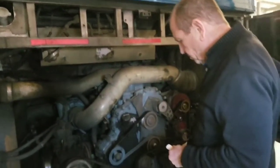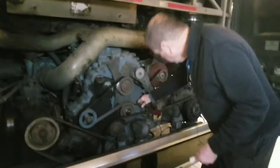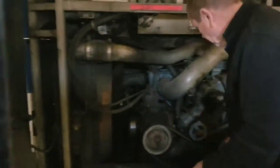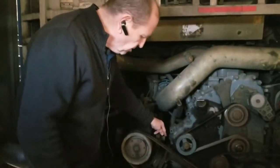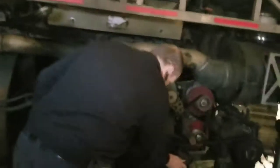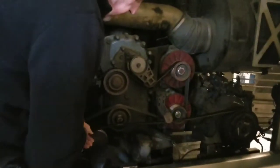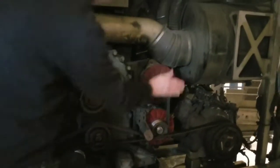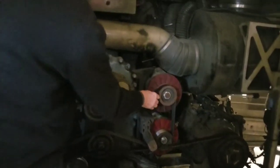I'm going to check my belts. Make sure all my belts are not frayed or cracked. Check my water pump — it sits back here and is gear driven. I want to make sure it's not leaking. Check my power steering pump — make sure all my bolts are in place, it's secure to the vehicle and not leaking. It is gear driven. Check my alternators — make sure they're secure to the vehicle. My alternators are belt driven.